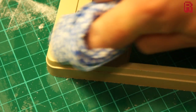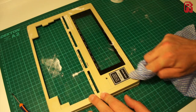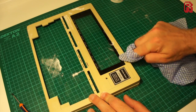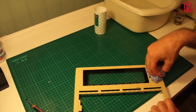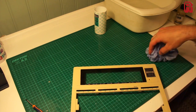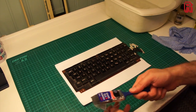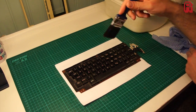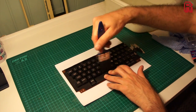On each step make sure you cover every single part of the case. As tedious as it may seem, the last thing you want is one yellow patch left at the end of it, so take your time. With the baking powder finished, let your plastics dry naturally. You may want to use this time to work on other parts — for example, I'm using a brush to clean out the keyboard of years of lunches, fingernails and who knows what else.